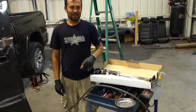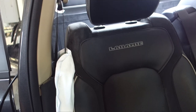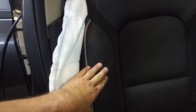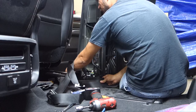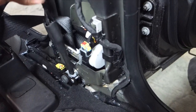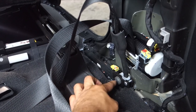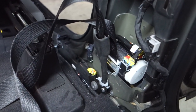It went out a little bit, but not as much as I was hoping to, so we're going to have to figure something else out. Now we're going to get this seat cover off so we can get this airbag out. Once this comes in, we can replace the airbag. We're going to take this to our upholstery guy who knows how to sew these up so that everything's right. We're also going to take off the seat belt that's locked in. This has a dual-stage seat belt - the seat belt itself locks it and then this pulls in. We've got to remove the one Torx bit screw there, and that will release this and the seat belt itself.